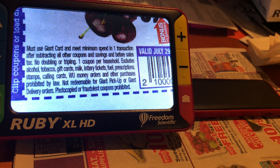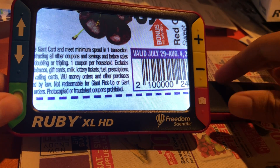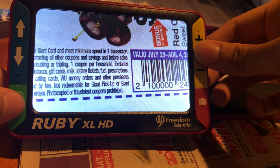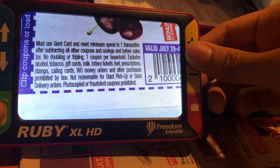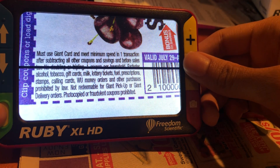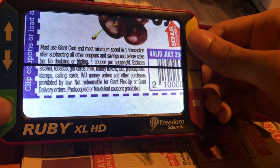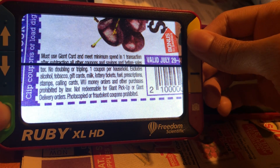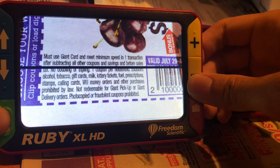Reading lines and reading masks can also be activated as needed. This makes it easier to follow along on some text. To do that, I simply press the power button and then press the plus and minus zoom buttons at the same time. That will activate the reading line. If I want to adjust the position of that line, I would simply hold the power button and press the plus or minus zoom buttons to move it up or down the screen.